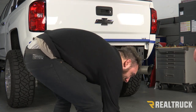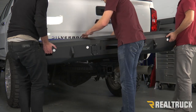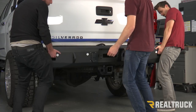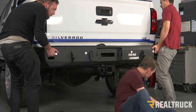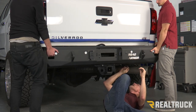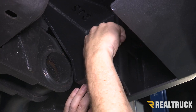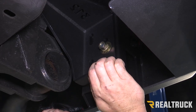What we're going to do is employ the help of a couple of friends. Raise it up. Now as we're bringing it into place, we're going to go ahead and attach our wire harnesses. We're also plugging in our trailer receptacle. Once we get it lined up, we're going to put on some hardware — just hand tight for right now. Use a flat washer, lock washer, and three-quarter inch nut. This allows us to get this in place and we can adjust it high and low.